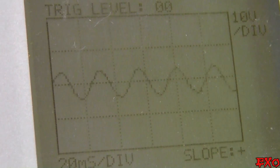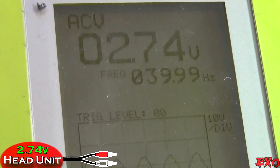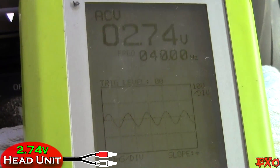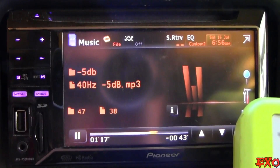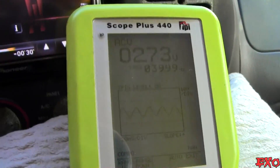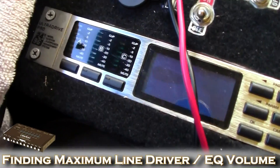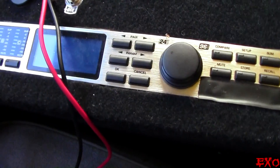As you can see, our wavelength is looking pretty good. We're matching up right there at 40 hertz at 2.74 volts. It's not very high — I thought this head unit would be a little bit higher than that, seeing as though it is a nice Pioneer. But now we know we can play a -5 dB tone on this head unit at full volume with zero clipping. Now, let's get down to the next component, which is going to be the Behringer sound processor — but for you, it might be a Clarion processor or a Rockford. Let's get down into these outputs now.